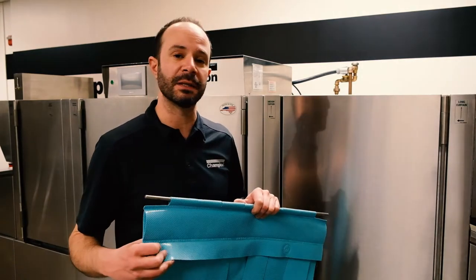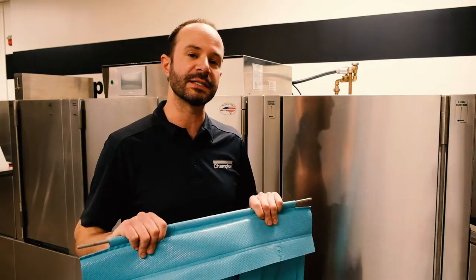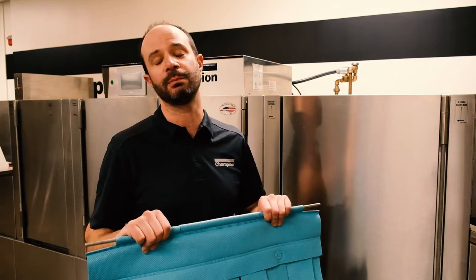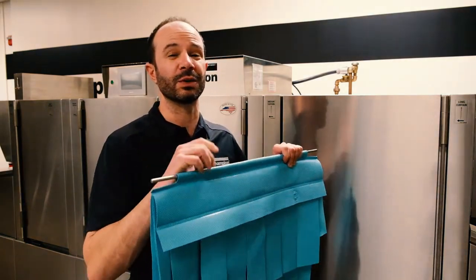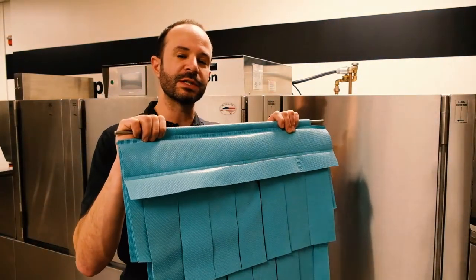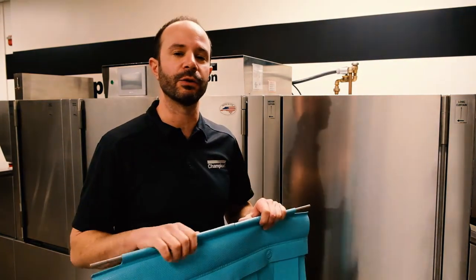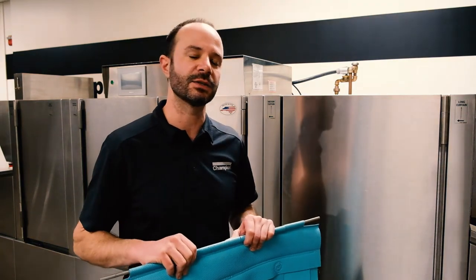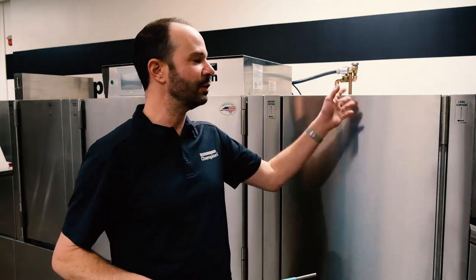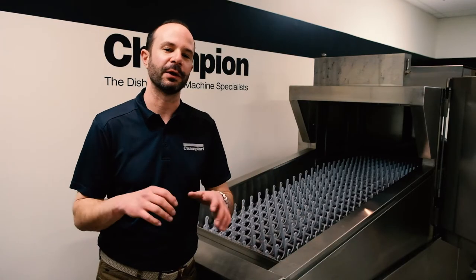On a daily basis, pull these curtains out — they just sit on nice little hooks inside the machine. Take them to the three-compartment sink, give them a wash-down, pull them up and get in between them for a nice rinse. These are replaceable items, typically replaced once a quarter or every few months — mainly a visual check, because heat, time, chemicals, and water will make them brittle, and some may tear. It's a very normal replacement item. From Champion: we have designed these specifically and in a very calculated way to keep heat inside our machines. There are less expensive options that don't quite keep heat in the way they should. Keep your curtains clean, give them a daily rinse, let your manager know if one is wearing out, and never use this machine without all curtains placed back in their proper places with the right sizes and correct direction or you won't get the results you're looking for.